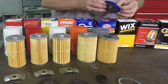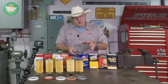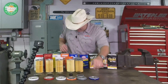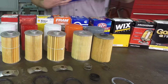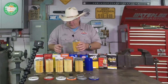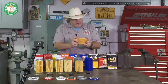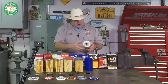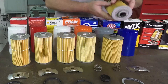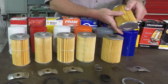Next we'll do the STP. The base is of heavy duty construction. I can't get the O-ring out of it — it's crimped in here, though not as badly as the Fram one was where it actually distorted the O-ring. It does have it held in there pretty tight — decent construction. Interestingly enough we have another spring that resembles the other filters, and we have a filter that very closely resembles those others, although it is different. Doesn't appear to be as rigid. There's no joiner bar to join the pleats together, but the filter material looks very consistent all the way around with some pretty deep pleats. The filter material feels solid, not papery or flaky.